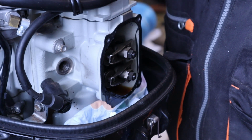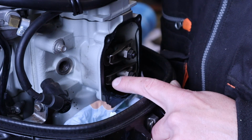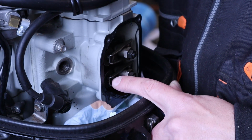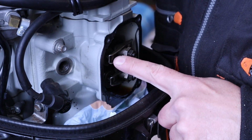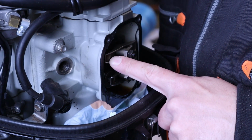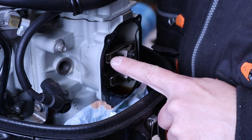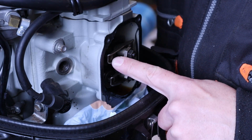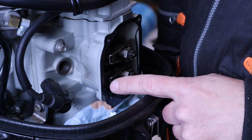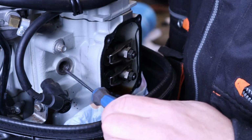So we start to spin the flywheel and notice that the exhaust valve is pushing down. So we know that was an exhaust stroke. And then the intake stroke begins and the intake valve is pushing. Now the piston is at the bottom part of the stroke. Now it starts to come up, and the intake valve is coming up again. And when they are both up and the piston is at top dead center,